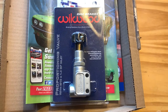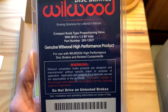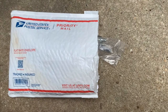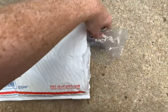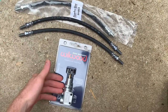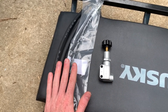I now present to you a new brake fluid diverter valve, also known as a proportioning valve. It splits the percentage of brake pressure between the front and rear calipers, and mine had gotten stuck because there was no fluid in it for such a long time. I purchased new lines and this new diverter valve, but some funky stuff went on later. Replacing the master cylinder on the Alpha has turned into a very long and frustrating project. I'm going to have to replace all of the hydraulic lines as well as the diverter valve. Lines can get corroded on the inside and won't allow fluid flow — that's what happened to the lines I had because they were so old.